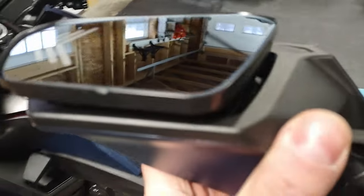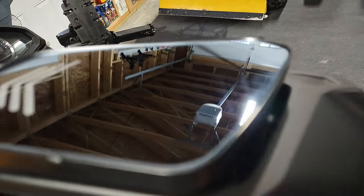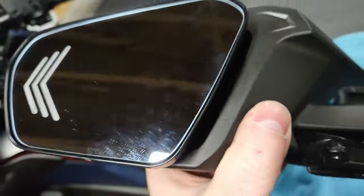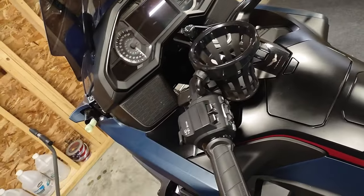Working by yourself is a bit of a pain, but you can see I've got the white cord up in there. You connect the connector while the mirror is hanging, put in the two screws, and make sure your wires are up underneath. Clip the mirror back on just like you would the original. I've got the two wires here — I'll clip this little thing off, and then the original plug will plug right in. Then I need to fish the new line all the way down to my pathfinder box.